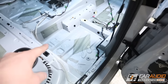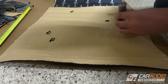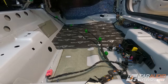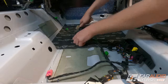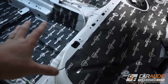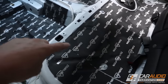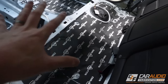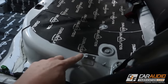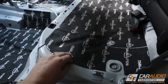Now much like the doors, I'm going to start with prepping the surface, cleaning everything off, and then I'm going to cut around any wire harnesses and any holes, add holes in the material where needed, and then stick it on much like usual. And with that we now have the entire floor of the vehicle sound treated. I used two different materials in here — the normal SoundShield material in most areas, and the SoundShield slim in the back because there's not a whole lot of tolerance for the clips to work correctly there, so I didn't want to mess with that fitment by using a thicker piece of material.